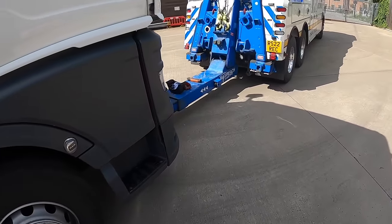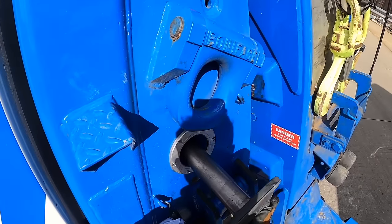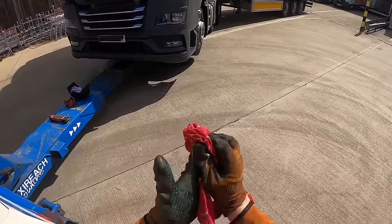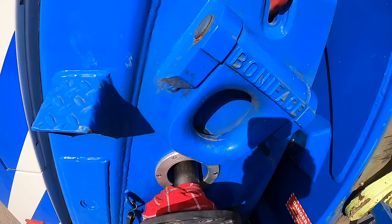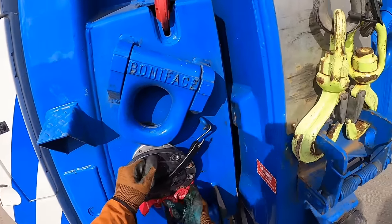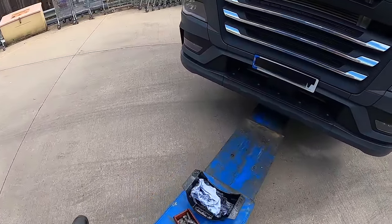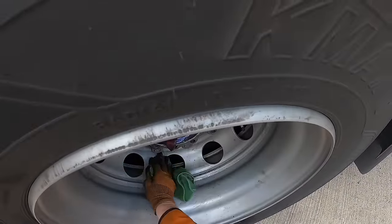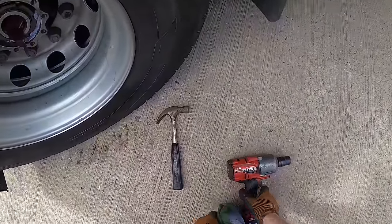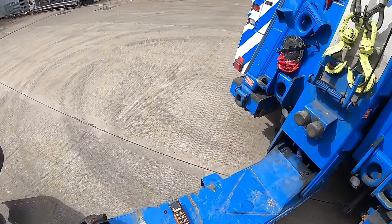Put this half shaft back in there. Unfortunately the half shaft holder — the little plate's not wide enough so it tends to rub the paintwork — so I took a bit of rag under there to stop that chaffing away going down the road. There you go, get the wire open to find it. There we go, the off-side shaft there. I'll probably jump up in there now and take the park brake off.